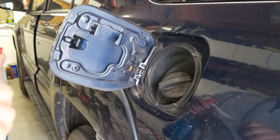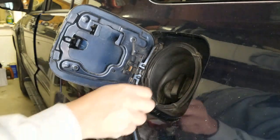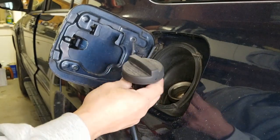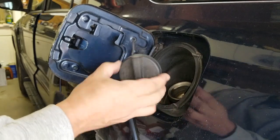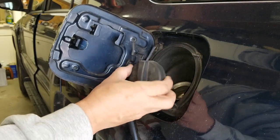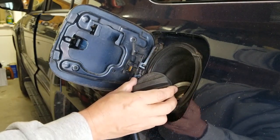So with this 4Runner, last time I got the check engine light with the VSC track light alarm on, I went to the store, I went to AutoZone or O'Reilly's, I can't remember, and I bought a replacement gas cap, because that's normally what makes that alarm trigger on the control panel on the dashboard. And it worked for a while, and now the light came back on.